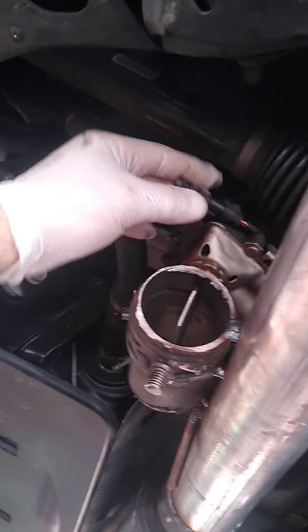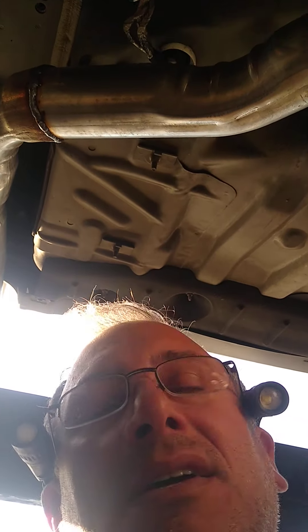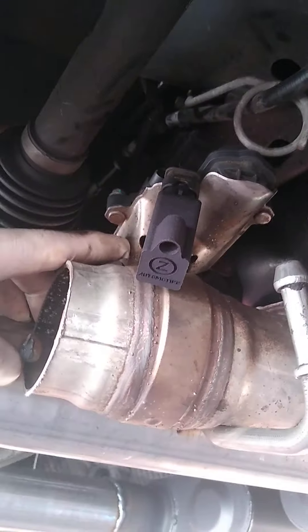Z Automotive appears to be the way to go. If you've got green crusties in yours, you have to get the connections clean or replace them. If your valves rattle, my recommendation is to take the electronic part off, open the valve — because these aren't stuck in the open mode — and weld them wide open so they don't rattle anymore. Or go to your local exhaust shop and have them eliminate it completely. Once you get the check engine light situation under control, I hope this helps somebody. Thanks for watching.